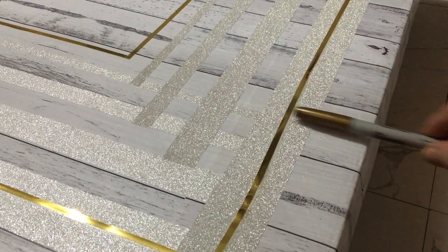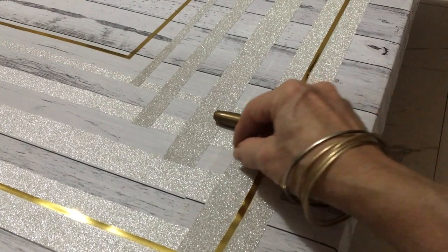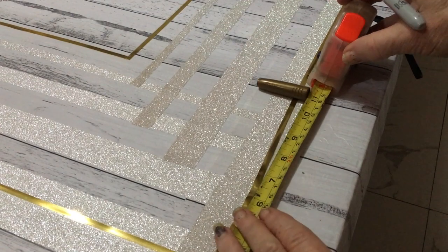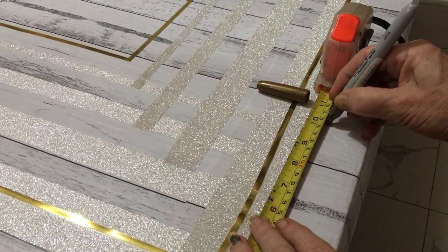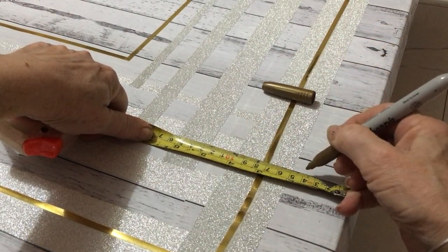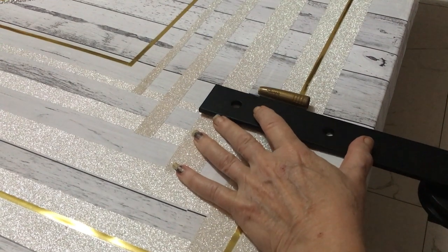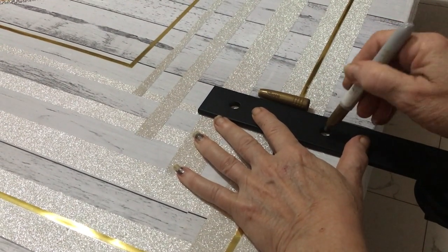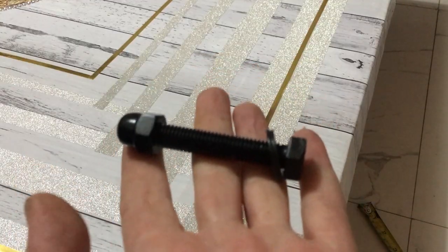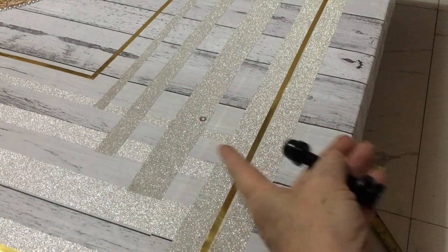At the top of the door where I placed all the plastic, which is 26cm in, I'm now going to be measuring down 4cm to mark where I'm going to be drilling the holes. I've just placed the runner on top so that I can get the exact marking for the second hole. I've got my holes marked and I'm doing the same on the other side. I'm going to be using a size 8 drill bit because these are M8 bolts that have to be attached here.